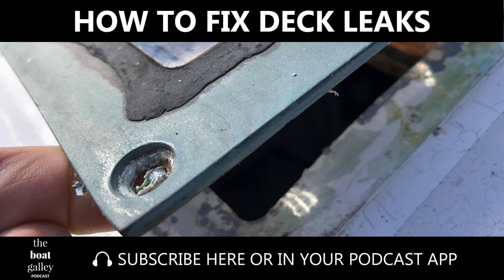After you have put your sealant on your fasteners, screw them down. The thing with butyl tape is — unlike some caulks where you want to just tighten enough to start having stuff squeeze out and then come back and tighten it down the next day — you don't have to do that with butyl tape. You can keep fastening it down. What I do is screw it down until I see a bead of butyl tape coming out of the side. That way I know it's in pretty good shape and it's not going to leak anymore.